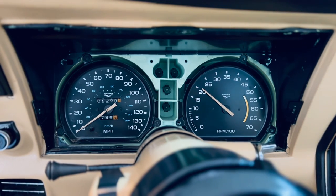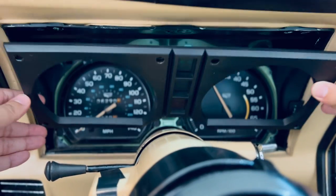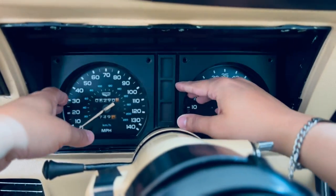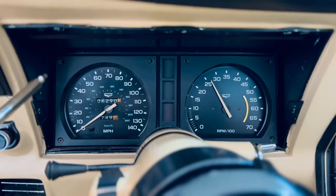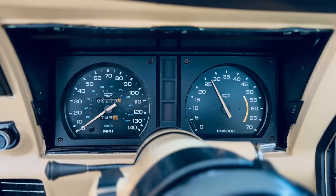All right, remember, we're going to start by installing back the tach board. Now that we've got that installed, don't forget to install your cover for the panel. And again, just be careful with the needles. Try not to touch any of the needles or any of the other boards. Once again, take your time. It takes patience. This job takes about 30 minutes to do.